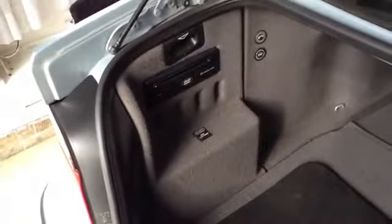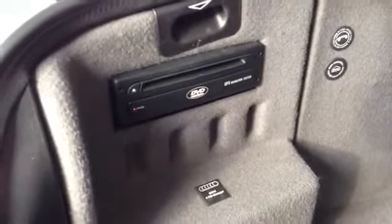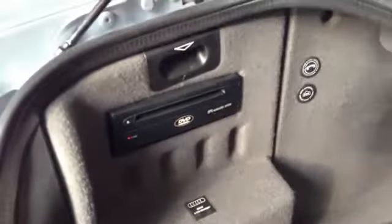And today we're finally doing the navigation upgrade. I've been talking about this in this car for a long time. As you can see, we're still running the 4x3 display in there right now, since that's what was included prior to September of 2000 production, and the MK2 computer, which this is actually the Mark IV in here right now. The Mark II has already been removed, but I will be detailing the entire process, how to remove that.